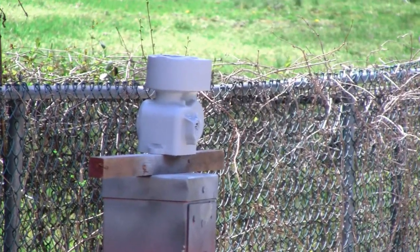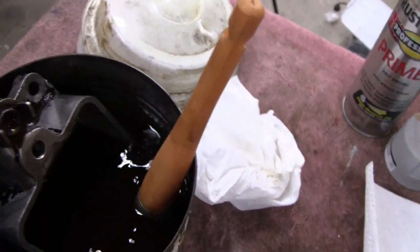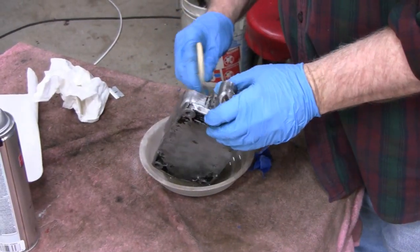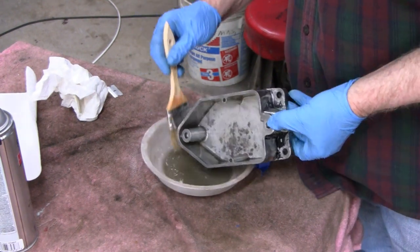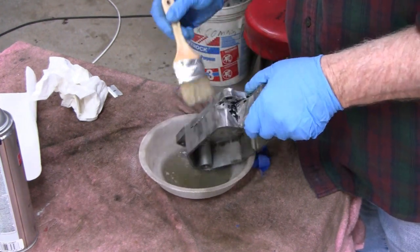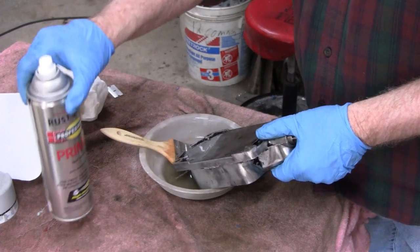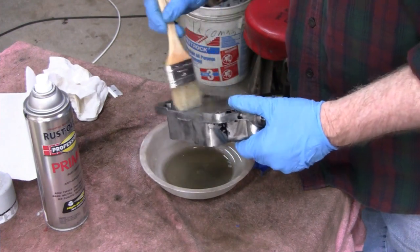That's tacking up a little bit. I'm gonna clean the base up here. I'm getting all the grease and oil off of it with gasoline and then I'll clean it up with lacquer thinner. You know, gasoline is petroleum and it's oil based, so you want to get all that off. The best way to do it is lacquer thinner. These aluminum bases — aluminum you should really paint with some kind of zinc chromate. But I've just used that regular primer, and I've used that on all my engines and we've had them five, six years, some of them, and I've never had problems.